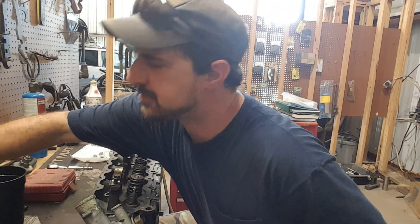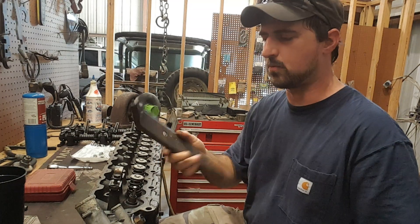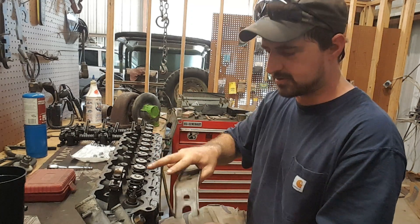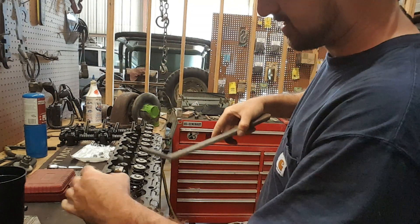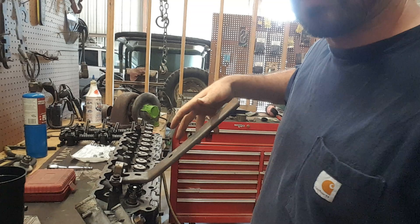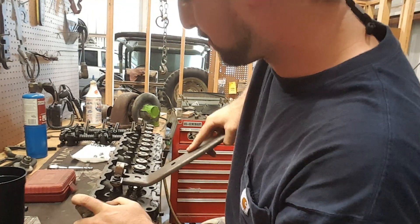Because I'm poor and I don't have sponsors, I've got the cheapest valve spring compressor you can buy. It's very simple — just works on leverage. There's another type that's almost like a big C clamp; it goes under the head, holds the head of the valve, and pushes the valve spring down to let you get the keepers out. This is the old school kind. The way it works is you need a bolt that fits in the rocker arm stud area. There's a little hole here that goes down over the valve stem itself, and when you push it down, it actually pushes the valve down.